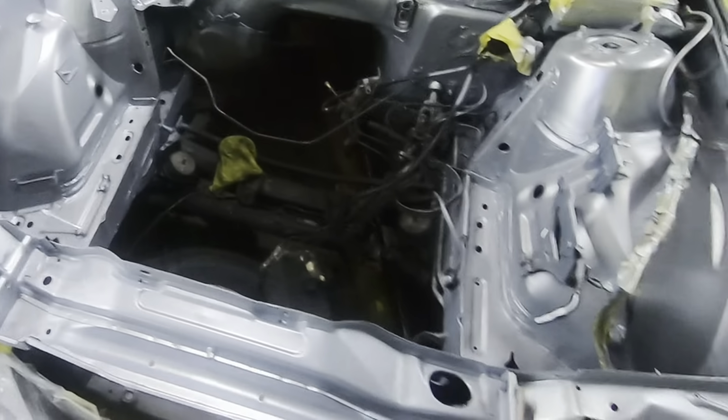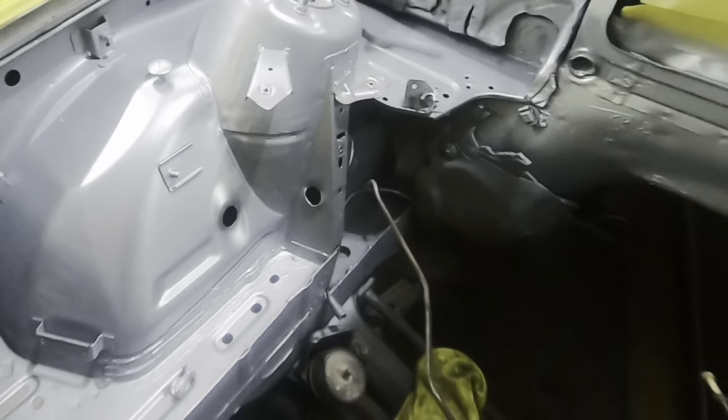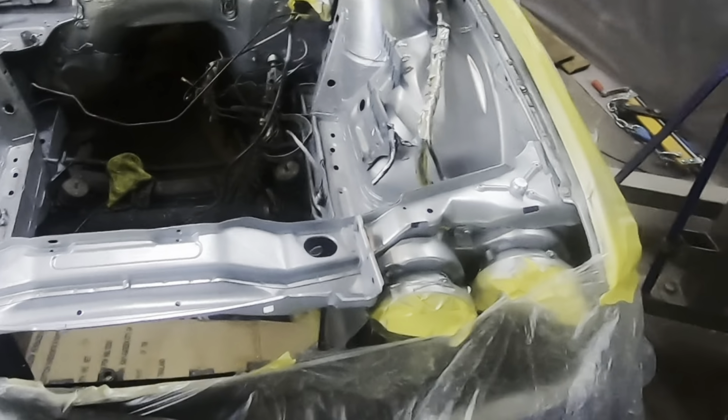Coat of base down, didn't go too heavy, just wanted to get a nice cover coat on. Just went for the coarsest silver that I could find with a bunch of pearl in it to hopefully make the candy pop. I'll give it about 5 minutes, then hit it with one more, and then I'm going to mix up some silver flake in some clear and top coat it with that, let it dry, then come back through and do all of my blue candy graphics.